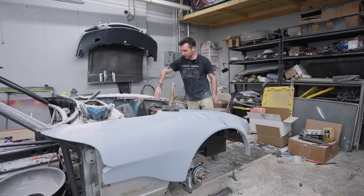Probably just cut that out, use a little heat gun, heat form it, little epoxy in the corner, black out the back of the lens, glued in there permanently, not removable. The light will be removable from the back. And then we'll do some carbon ducting so you don't see down. Well, you wouldn't really see anything anyways. But yeah, I'm super, super happy with this. Obviously all this stuff needs to be blocked with 180 and then satin cleared.